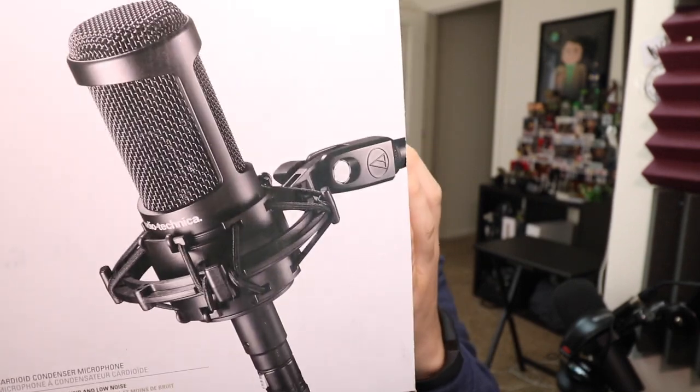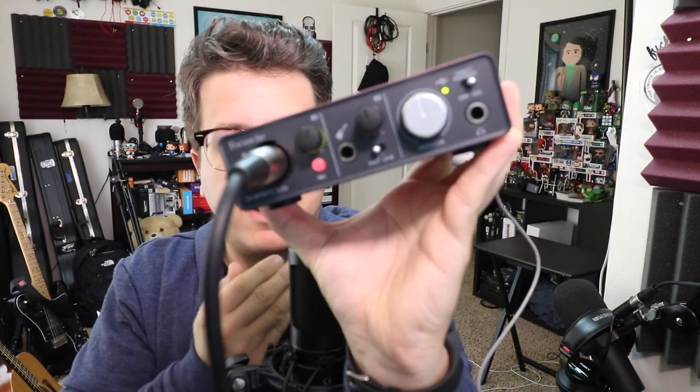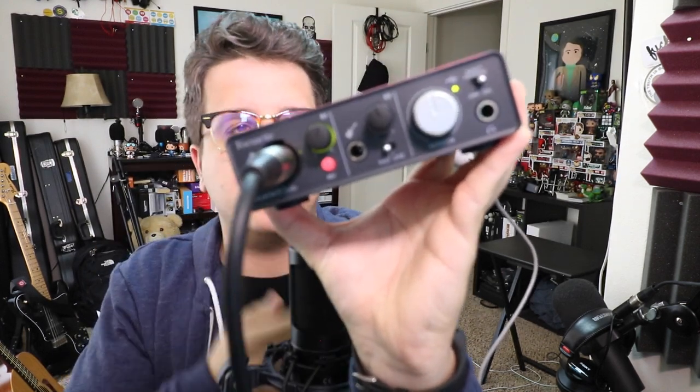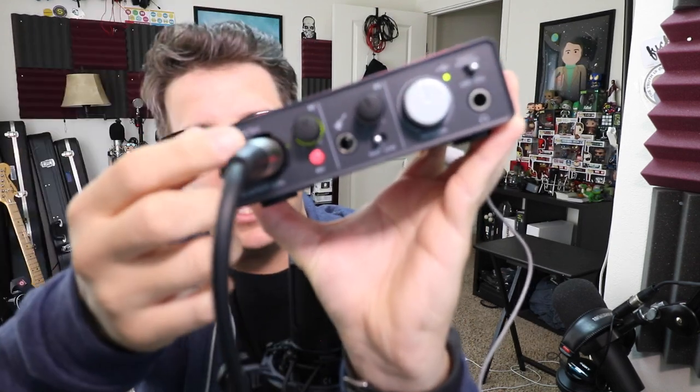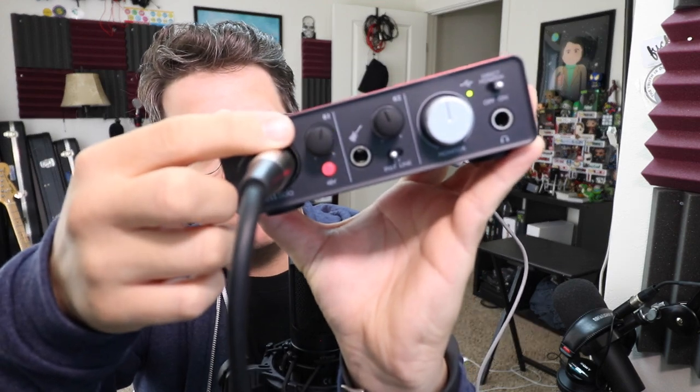As first requested by viewer Swifty Ice Gamer. This is an XLR condenser microphone, which means it does require a full 48 volts of phantom power to work. That means this microphone will not work plugging directly into your computer, and it will also not work with an XLR to USB cable. I'm connecting this microphone to my computer using the Scarlet Solo USB audio interface with full 48 volts phantom power on, and my microphone input gain is set at about 50 percent.